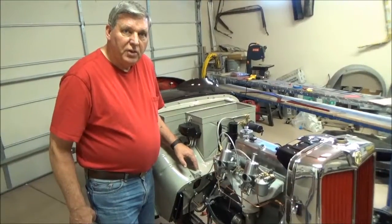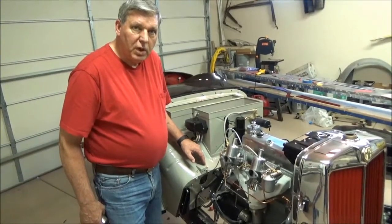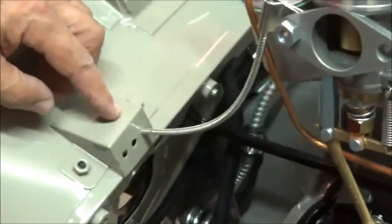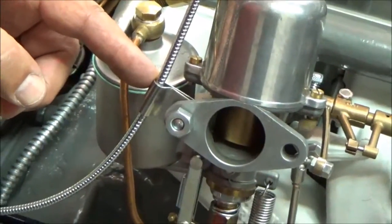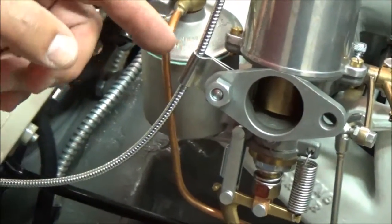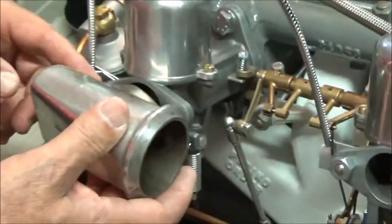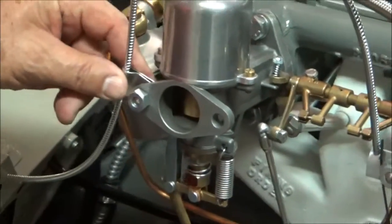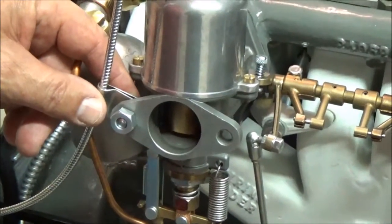We've got TC 1675 under construction. We can use this as a mock-up to show the slow run setup. The cable comes out of the control box on the bulkhead, and then it's going to loop up to the clip on the rear carb. We call this the N1 clip, and this is held not with a nut and bolt here, but a bolt that actually goes in the back of the air manifold, so it does double duty, the bolt holding the clip and the air manifold itself.